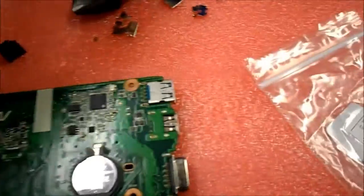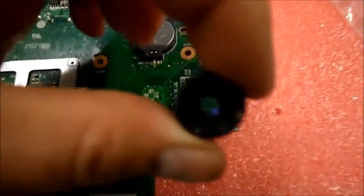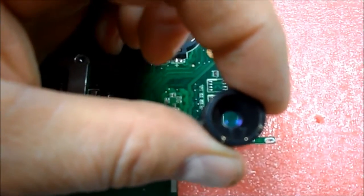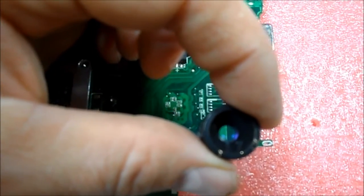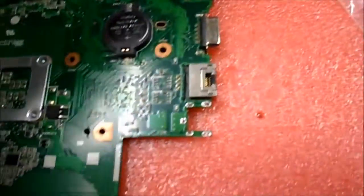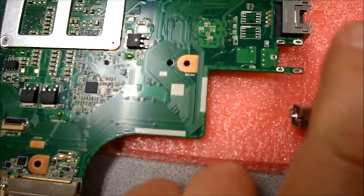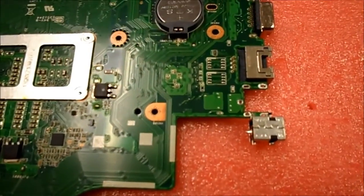There are the fragments we cut out. You want to have a loupe — a magnifying glass — so you can check your work and make sure all the holes are cleaned out. They don't make this easy. The newer laptops have a pigtail on the DC jack, so you don't have to go through this annoying process when you need to change the jack.